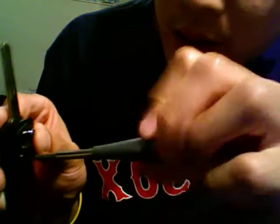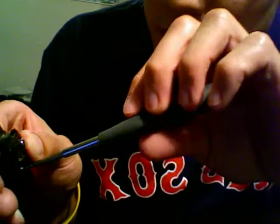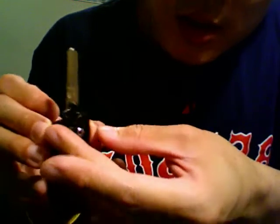Now here's the tricky part. On the last screw, you're gonna have to flip this key up, because that way the spring's not gonna be wound up quite as much as when it's sitting down. And then you're gonna undo this. Hold down with your thumb on that metal base plate so that it doesn't spin all crazy and just fly out somewhere. Okay, so that screw is loose. So I'm gonna place that onto the side. Now this is going to start spinning. You see how it's spinning?